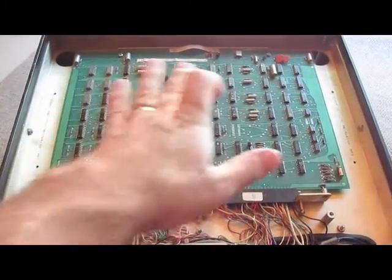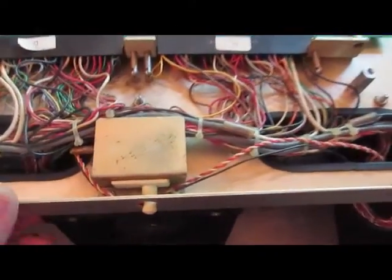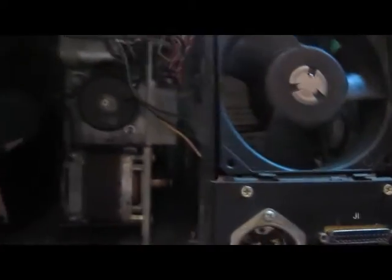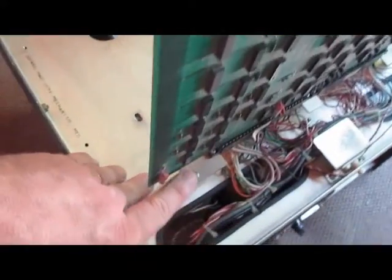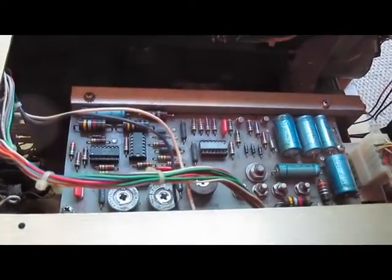Let's look at the inside of the disk drive. Here is the main controller board. You can see the two disk drives. We have to pull these out and take a look at their condition. Clean the heads, check the belts. If everything looks good we will turn them on and see if everything works fine. You can see how the disk controller board just lifts up, then there are a couple of thumb screws that lock it into place. Very nice for servicing. Down in here is the power supply.